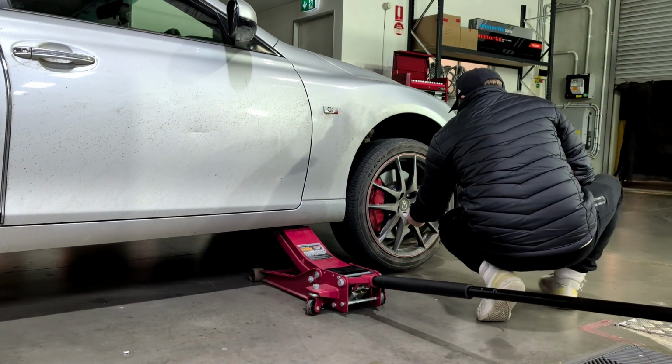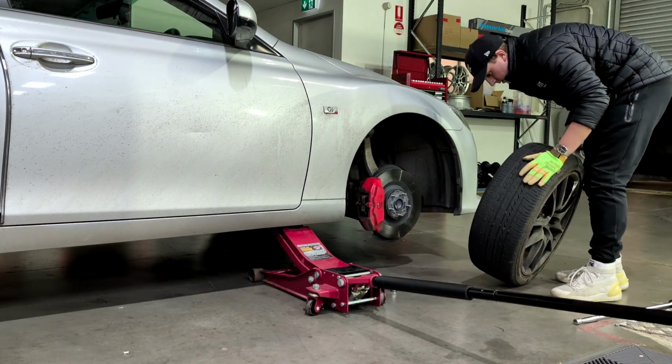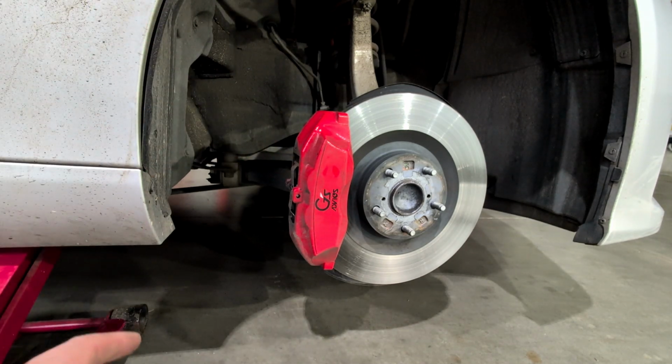Oh, let's get these wheel bearings out. Alright. So we're going to undo the 2 bolts behind this caliper. We're going to peel the caliper off, leave it connected. I'm just going to sit it on a box underneath. We'll take the rotor off, give the rotor a quick clean with some brake cleaner, and then we'll suss the hubs. Already saw the hubs about a week ago, because that's how we identified that the hubs were making the knocking sound. So we'll get the old hub off, show you guys how it shouldn't sound, how it shouldn't look, put the new one in, video the whole process, and then that'll be it.